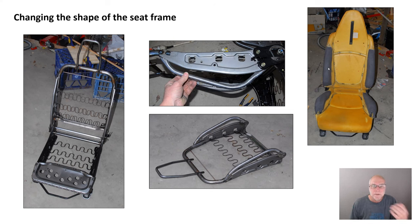You might be asking: what about the trim? Do I have to get the whole seat re-trimmed? What I've found is that if you're using cloth trim, it has enough stretch to go back over even seat modifications like this. You certainly don't want to wash it before you put it back on because it will shrink and then it will be really hard to put back on. But you put it back on, then wash the seat and it all shrinks and holds things into place really, really well.